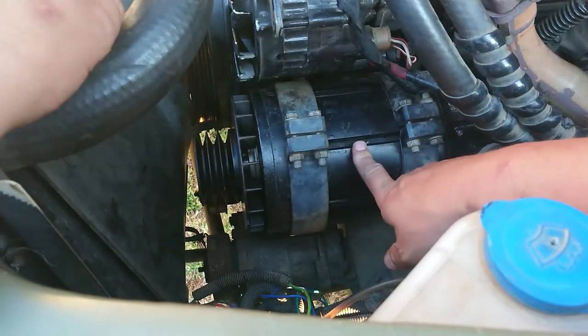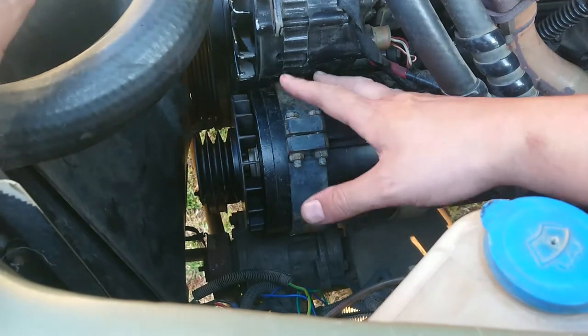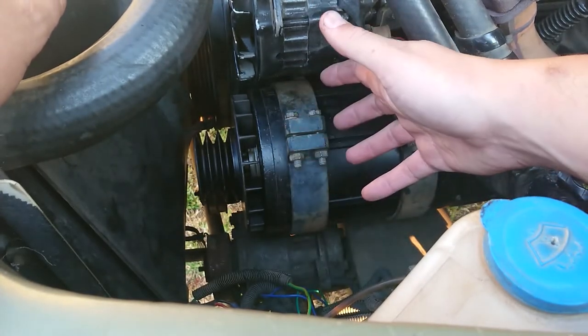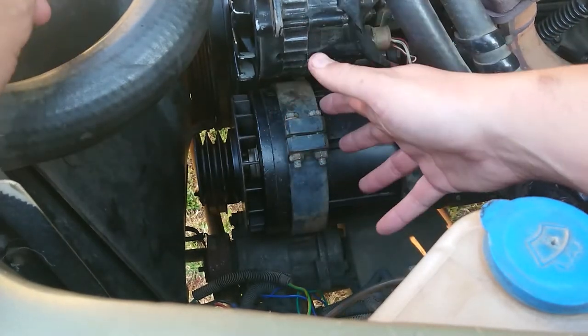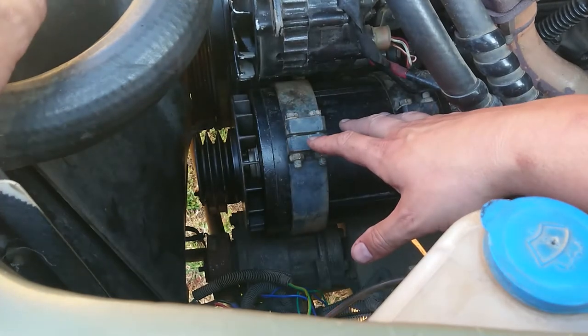What we're doing today is fitting this 24-volt alternator that we've just freshly reconditioned. My senior technician — aka my father — did work his craft on this: replaced all the bearings and spring washers, repainted it, cleaned it, scrubbed the crap off the top of the diodes, rewired it. It's in pretty well as good condition as it's going to get.